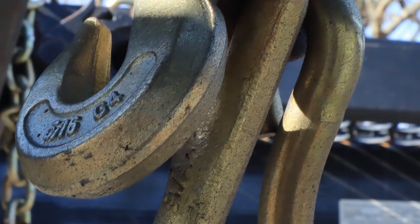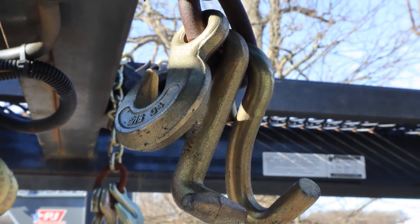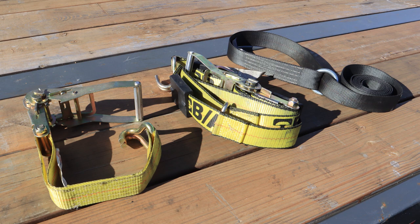Another option you'll want to utilize, especially for inops or Copart and IAA cars, is frame securement. If a wheel is missing or broken off and just hanging there, you need to secure to the frame. A wire hook will fit in frame holes, but they do make specific frame connectors you can tie down to. That actually compresses all the suspension instead of just putting pressure on the tire. Buy multiples and always get a few extra — these straps break, rip, and fray, and they're not easy to find at truck stops, so order more than you need.